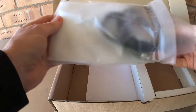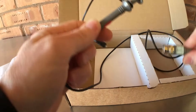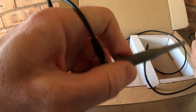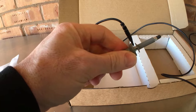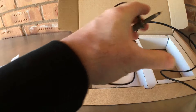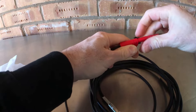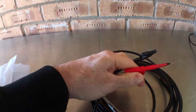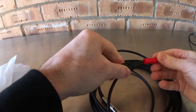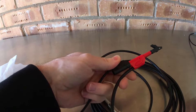These leads are okay, they work, but they're not really what you need for automotive applications — they're more for high frequency inputs. They've got a little hook tool and a small probe, but you can't fit a back probe on there with banana connectors. What you want is some Hantec automotive probes — they're really quite cheap and you can fit your back probes and crocodile connectors on quite easily. You can also piggyback them onto each other, so if you're using two probes you could share a single earth reference point.